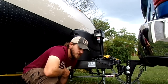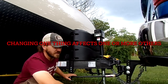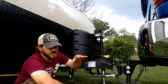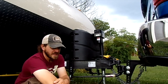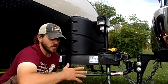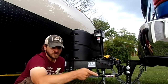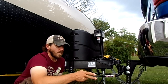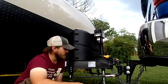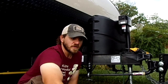We made it safely. The reason I didn't adjust it before going to Chincoteague when I first saw it was that I'd thought moving the bars up might require tearing apart the shank to remove a washer. The measurements on the truck were correct, and I thought maintaining that was more important than sway control being perfect — and I still stand by that. Weight distributed correctly is the most important thing. When I did make the adjustment down there, I retook the measurements on the truck to make sure everything was still balanced correctly.